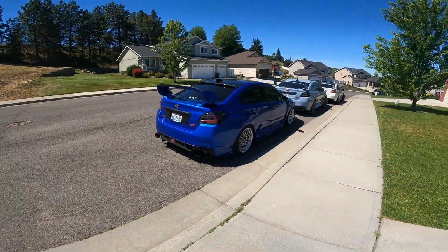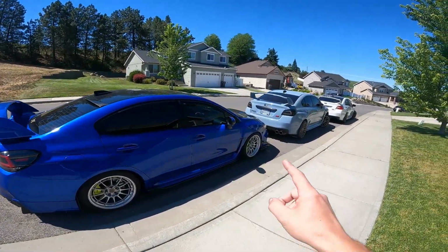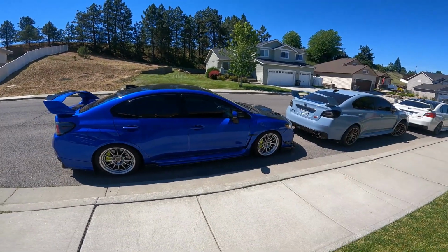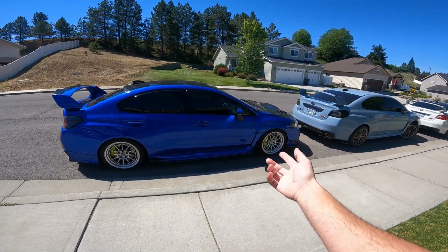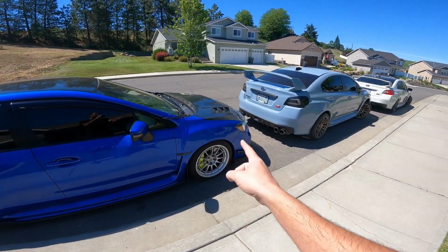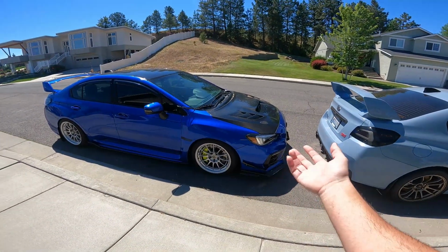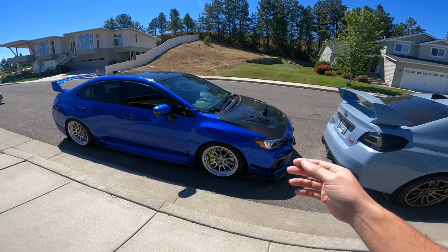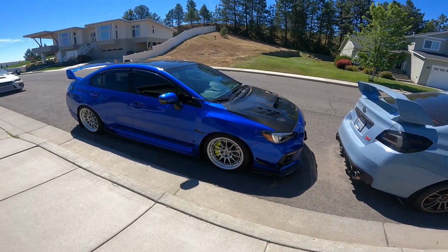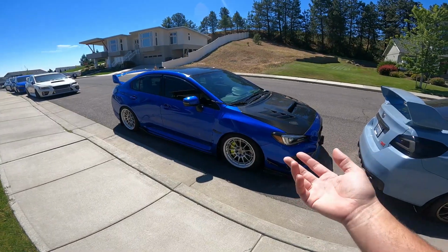But we did get this thing all tuned, and we did push the limits for these head studs on this car. For those of you that don't remember, when we did the build on this car, it is a stage 4 650 rated short block, but at the time JR had a FP Black, and he was trying to push to have stock heads, but I made him thankfully build the heads. We did BC 272s, definitely a smaller camshaft, and they still are a stock port with BC valve train and stock valves. But the downside here is it has 11mm ARP 2000 head studs, and that definitely held us back quite a bit. The car obviously has a 6466 on it now, and it is rotated.